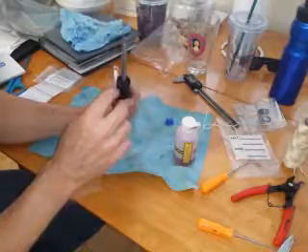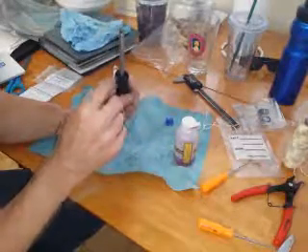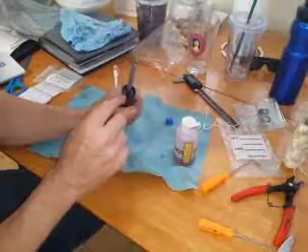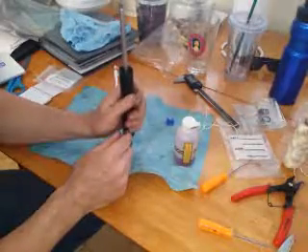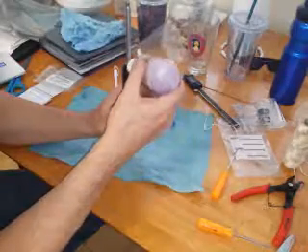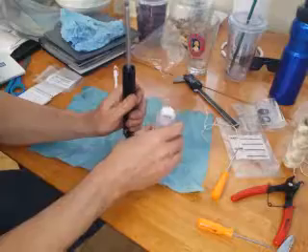When you get done, you should have just a little bit of oil on top of that slider piece where you can see the snap ring down inside there — maybe just about a sixteenth of an inch of oil on this side. I'm not quite there yet, just a little bit more and I'll be done.